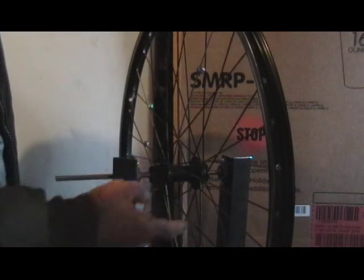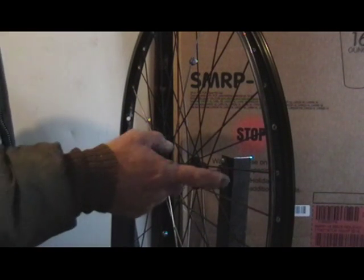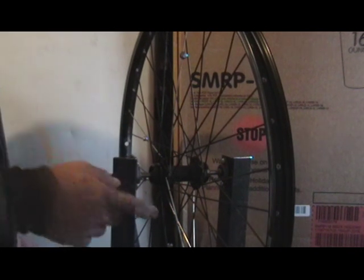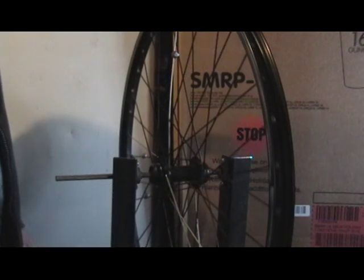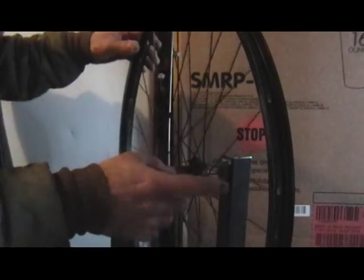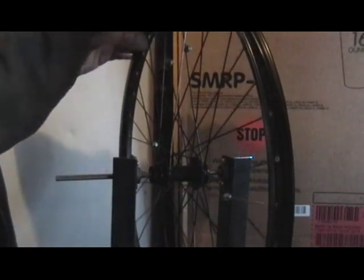With the slightest amount of touch, you don't want the wheel to roll backwards. As you go all the way around it, you're going to wait till it stops and make sure it doesn't roll backwards. That's the best way to do it. Now what I've done is I've got one, two, three, four — four weights, and they're all on this hemisphere up here.